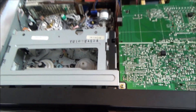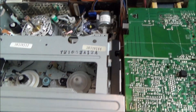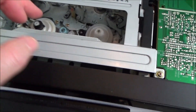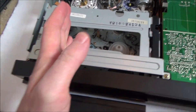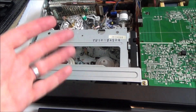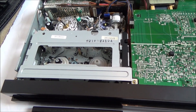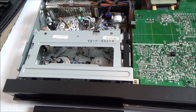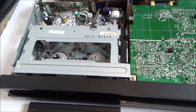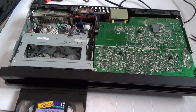I've learnt quite a bit along the way. If I'd had this knowledge prior to doing this I think I would have had more chance of fixing it. I don't think I needed to mess around with the mode switch at all — even though it looked dirty on the outside, the inside looked pretty clean. All the problem was to do with the idler mechanism and the clutch on the other side. We've got it working better than it was, but there's no way I would ever sell this as working because it needs new components. I can't find spares, but I'll keep my eye out — I've got a feeling spares will cost more than a working one.